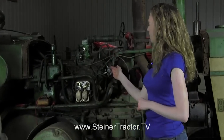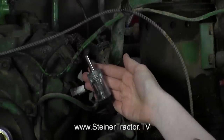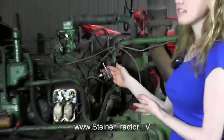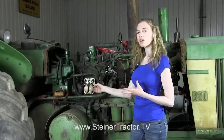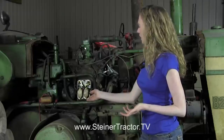To troubleshoot your tractor, you can hook up a spark analyzer like I have here. Then with the tractor in neutral, you can press the starter button and see if there's any spark. You can see just a really faint spark on my tractor — this is a sign that we need to do some work here with the coils. Additionally, you could inspect your coils; sometimes there will be a tar-like substance that melts out of the sides, which would be a sign that they've been damaged and need to be replaced.